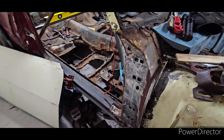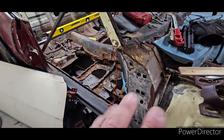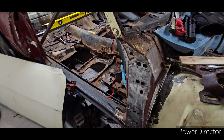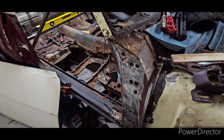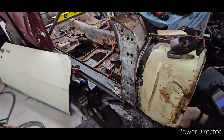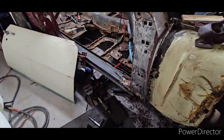The slide hammer is a perfectly valid body tool — there's nothing wrong with it. It got a bad reputation because lazy technicians would pull the dent, slap bondo over the hole without welding it, and filler would seep through the back. If you ever see a panel worked that way, you'll see little worms on the backside from filler pushed through the holes. The correct way: weld the hole up, grind it down smooth, and you'll be fine.